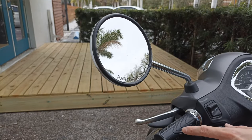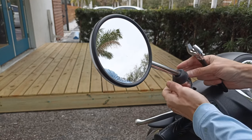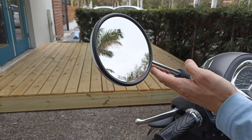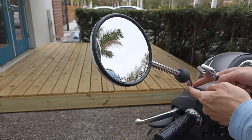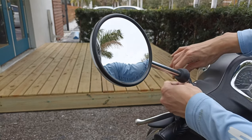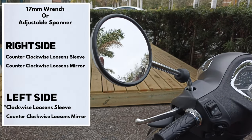All right, real easy for the right side. As far as the left side, this is where it gets a little tricky — the left side is threaded in reverse. Same story: we're gonna lift up the little rubber tab here. You can see I'm actually missing the 17 millimeter hexagon sleeve — long story short, I wound up breaking the mirror before this trying to take it off. If you can imagine the sleeve is on here, we've got our monkey wrench — to loosen it up we are going to go clockwise to loosen up that hexagon.